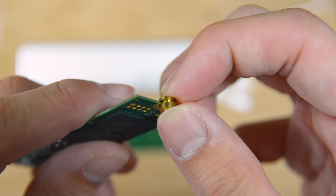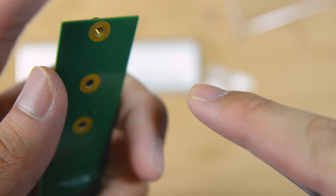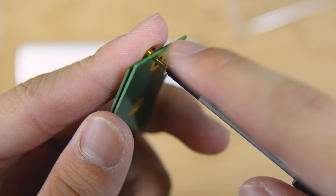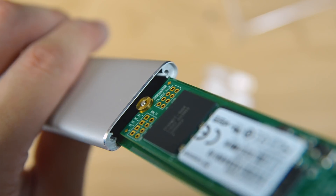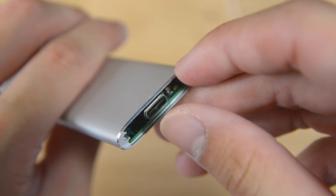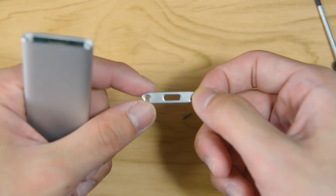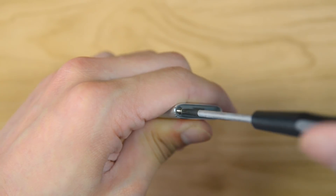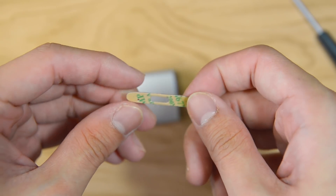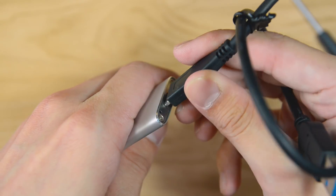Here's how you install it. Take the golden piece with the thick side at the bottom and slot it into the little cutout on your SSD. There are three screws — one of them looks odd, so just use that screw and screw it in. After that, you can slot the entire PCB onto the aluminium housing. Take the face plate and screw it in. Be careful — you will need the little hole to point in a certain direction, which should be closest to the PCB itself, because that is where your indicator LED will shine through.